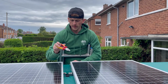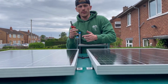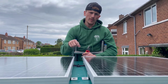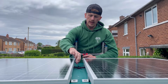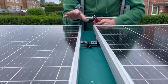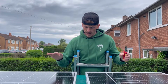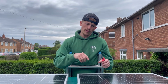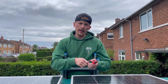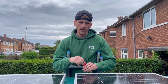Right, so what we've done now, we've put the sealant on, we put the sealant under the mounts, and then we've put some sealant through the bolts, bolted those down. We've now got these in place. We also tested the wiring down below to make sure there was an active current, which there is. I've then just used some cable ties for the wires that cross between the two panels to keep them in place. So now we're gonna cover the solar panels again with the sheet, just to take any power out of the panels, so that when we do the final wiring down below, which I'll show you in a minute, there's just no active current going through there. And then, fingers crossed, we should have solar sorted, and that's all the off-grid electrical system sorted. So, see you in a sec.